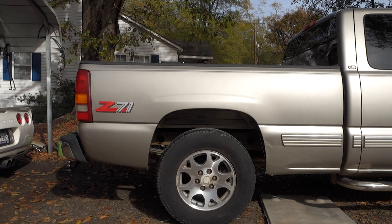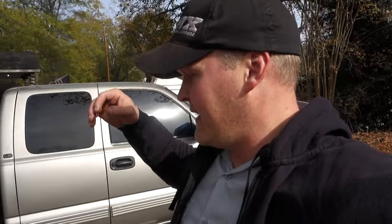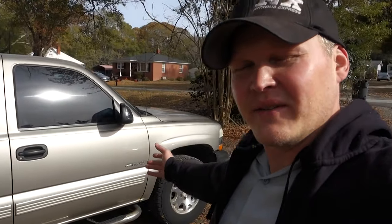That's not too bad. It's not stupid loud or crazy loud or anything like that. But I don't want it to be loud at all — I just want it to have a better sound than stock. So the plan is I'll put the Flowmaster on, fix that gnarly exhaust leak I have at the manifold, and just kind of fill it out from there. I know if I take the converters off it's going to make it way loud, so I'm not sure. I don't want it to be crazy loud because I want it to be comfortable when I'm driving it. We'll get the Flowmaster welded on there, let you guys hear what it sounds like, and then figure out if I'm going to cut the converters off or not.